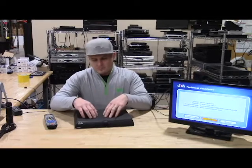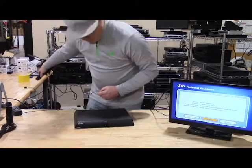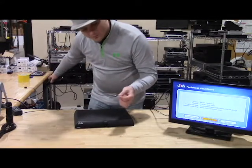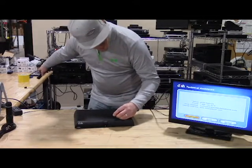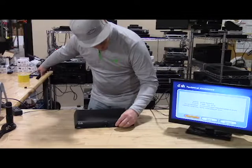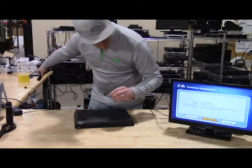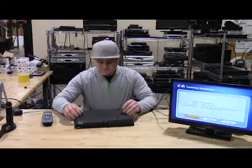So to demonstrate this real quick, I have my emitter placed on the device here, and if I start scrolling to the right, it works. Now if I take my loose emitter head over the dual kit and I bring it in front, it stops responding because now it's getting 2 signals. If I pull it away, it starts responding again. That's what will happen with a double IR signal.